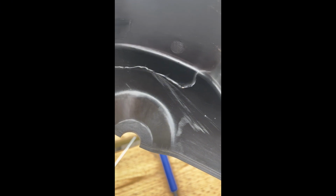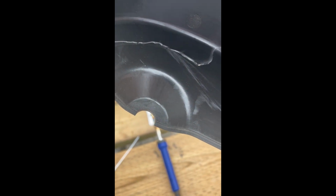So here I am going to weld the first outside piece. That foil apparently is used to hold the crack together. So if you look closely, you can see that fine hairline crack, so holding it together. And there's the ugly one on the inside. And I'll be cutting some mesh to go over top of that crack and melting it in, similar to that other piece, just to provide that structural integrity.